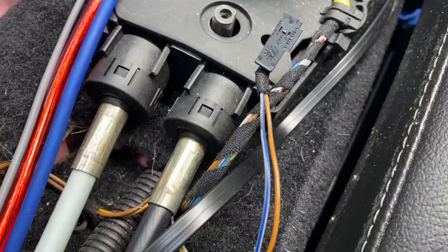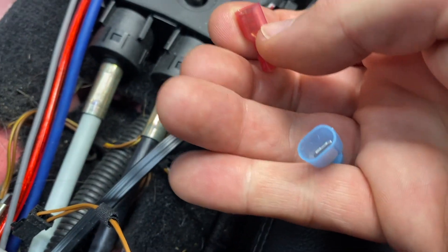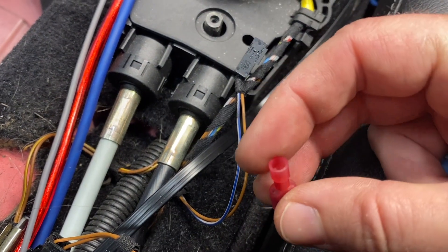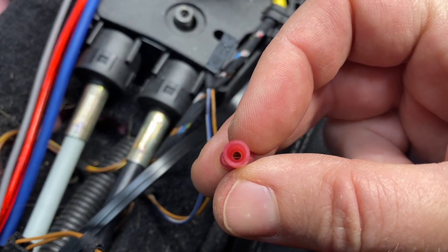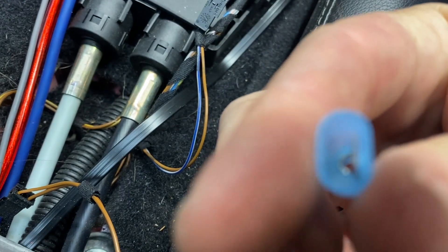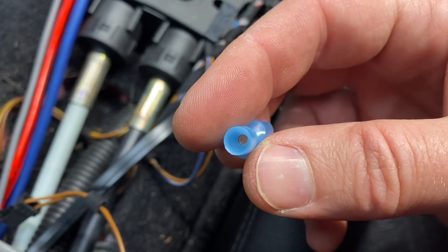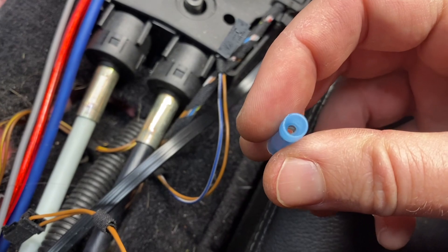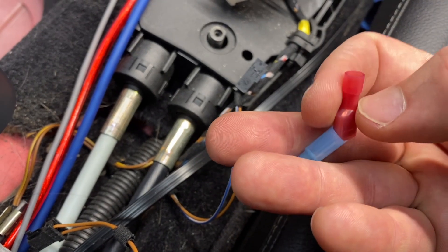Now I just have to figure out the best way to splice two wires — one from each of our switches — into this. In that terminal kit we have female and male ends. I'm going to cut the wire right about here and attach a female end onto it. The red terminals are for 18-to-22 gauge wire and the blue is the medium one — same size connectors but a wider hole to accept a bigger wire. I think I can twist the three wires together and crimp them down, connecting all three right here.